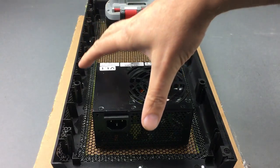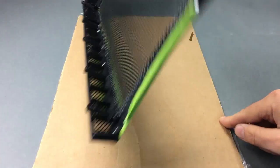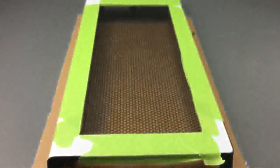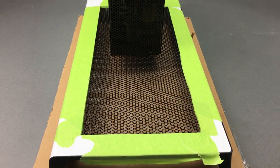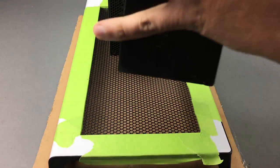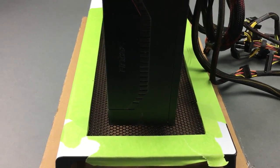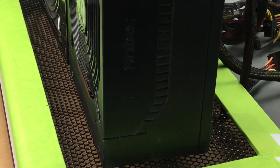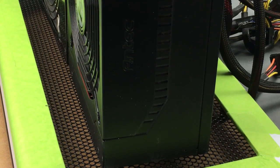After 24 to 25 hours for the DP190 epoxy to cure, let me show you how strong it really is. This old Cooler Master 1000-watt power supply weighs seven pounds — holding strong at 25 hours. This Antec 750 weighs five pounds — also holding at 25 hours. It's strong — more than enough strength for a front bezel grille.